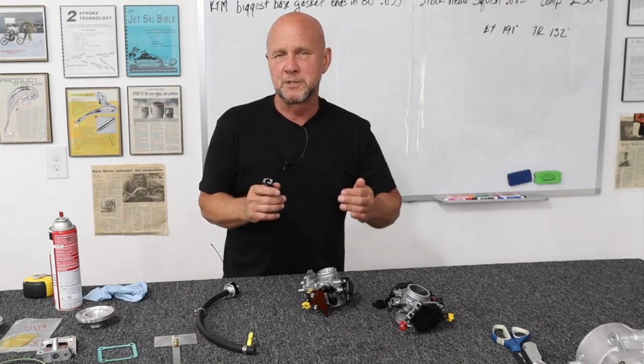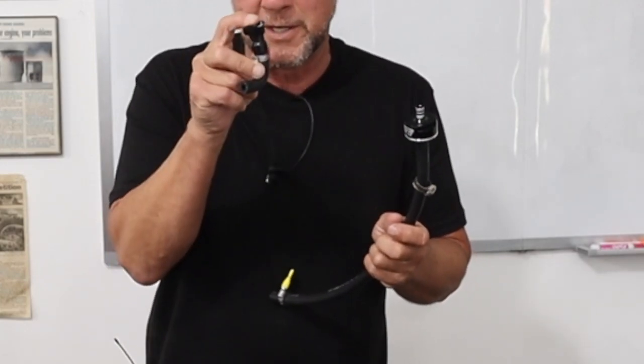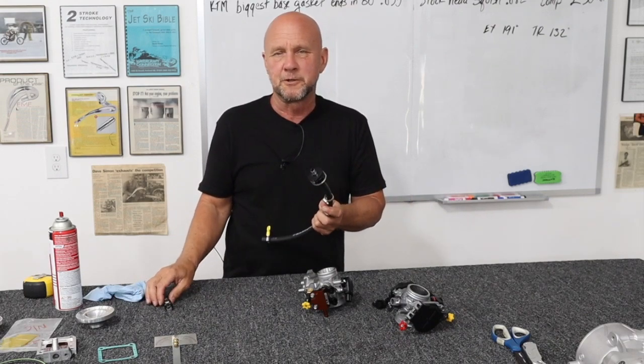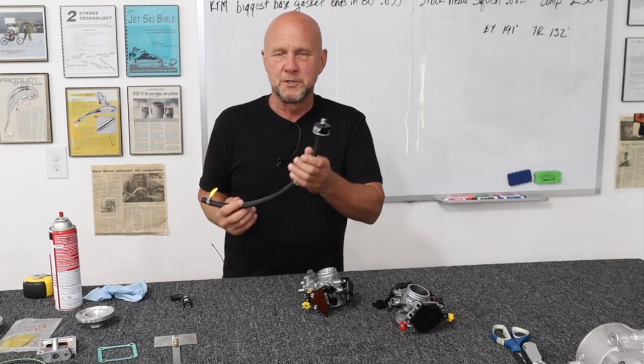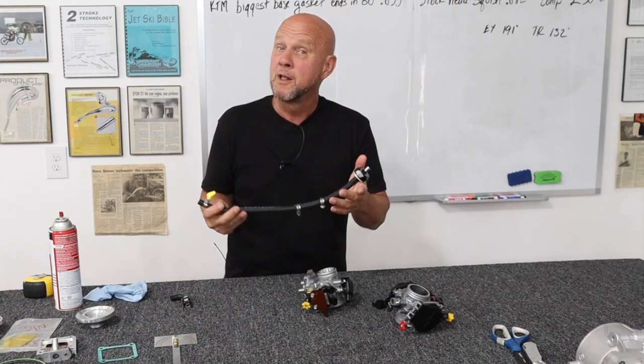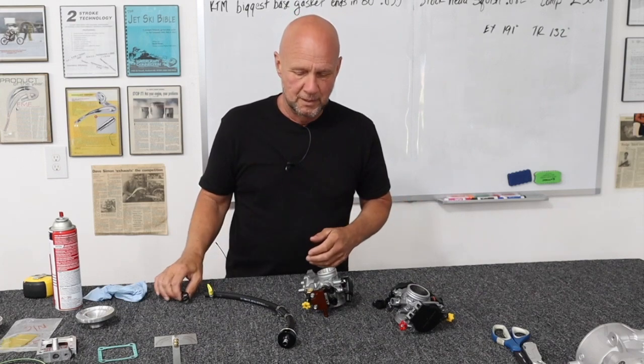In this case, it was the other thing that was causing the bike to run out of fuel. I knew that because I switched over to our little clamp-on-style filter, which eliminates this part of the quick disconnect. By eliminating this plunger system and just using the clamp-on filter — where it's just hose in both places and you're just using those clamps to put it together — that solved the leaning out. I did try the metal ones of these things, because I know people like that. Maybe it had a different plunger system, maybe it was a little bigger. Ironically, it was worse — it sure as heck wasn't better.